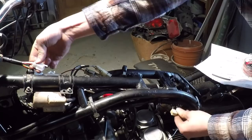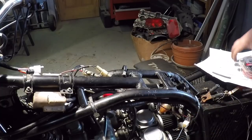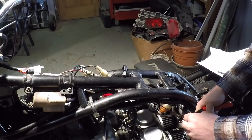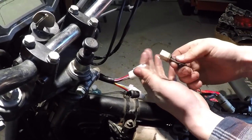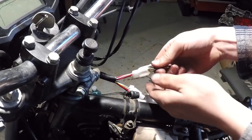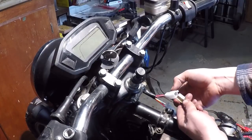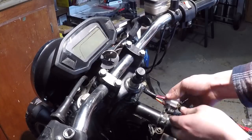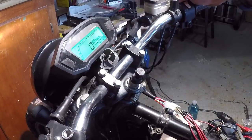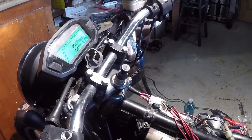As you can see, those wires are definitely not going to plug into each other anytime soon — I'm going to have to cut them and extend them with some wire so they can reach the connector. Fortunately, the stock old connector actually fits in the new one pretty much perfectly. We've got all the wire extensions connected to the old connector — let's plug it into the new dash connector and turn the key. It says neutral — so it works! It reads second, third, fourth. We got really lucky on that one and it works perfectly.